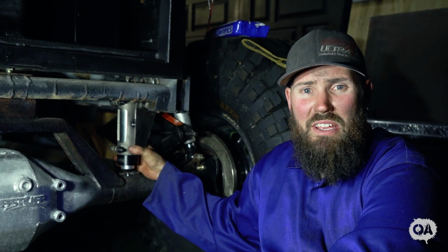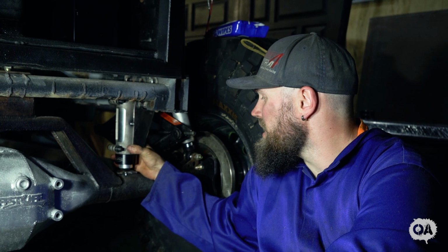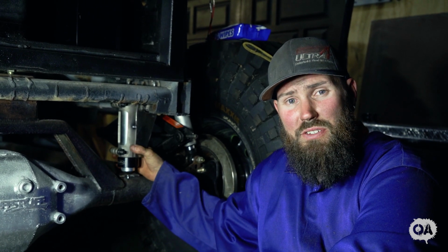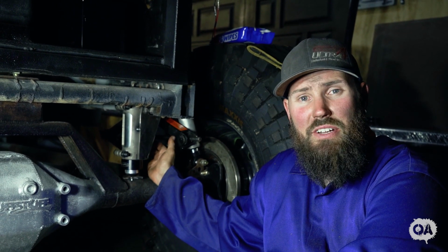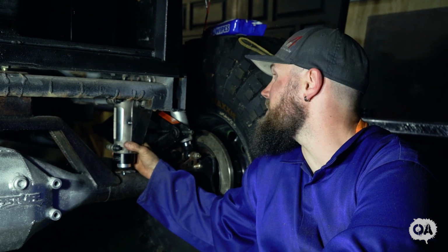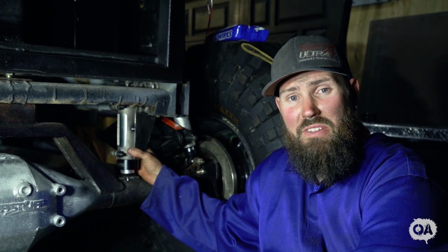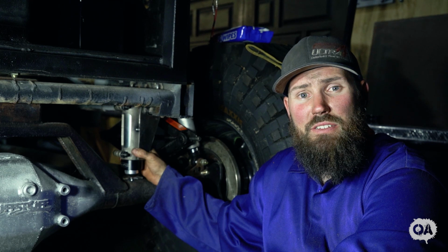The terrains that we play in don't really let us go really fast, but the hydro bumps, my ones are a 4-inch, so they're a 2-inch body and a 4-inch stroke, and I'm probably going to have 4 or 5 inches of ride height in the rear, so they're almost going to be touching the whole time. With the 2.0 air shocks, it'll probably work quite well as extra bit of dampening, and it will take up the big hits if we need it to.